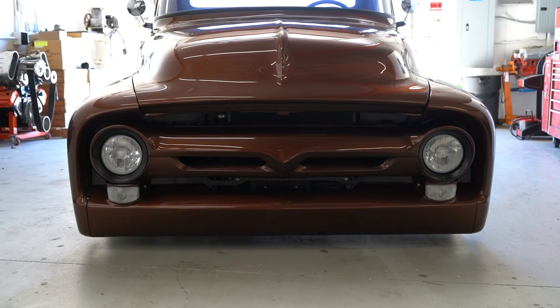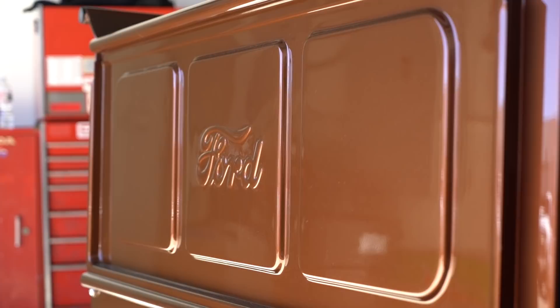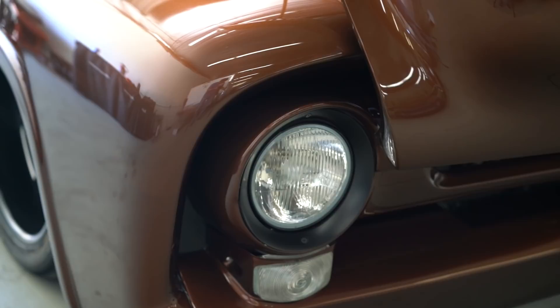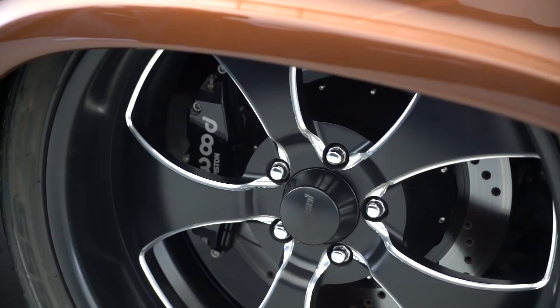If you didn't see the Galaxy episode, you don't know this man — this is Jim, Bones Fab. Jim builds some pretty radical stuff, so I'm looking forward to hearing about this one. The '56 F100 — I built it for a customer. It's actually a stock chassis that's been modified. It's got a TCI Mustang II front end, a nine-inch with a four-link out back, air ride shockwaves front and rear, AccuAir controls, and big brakes all the way around.